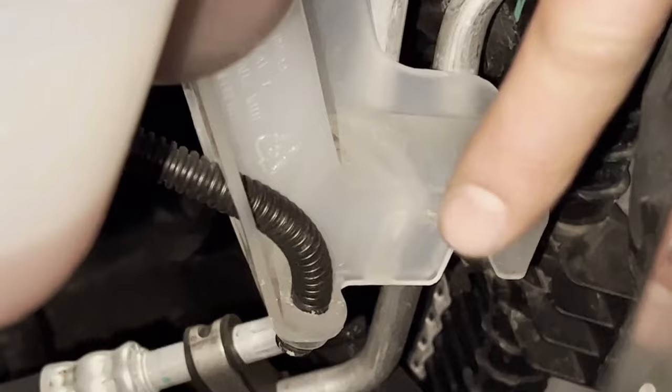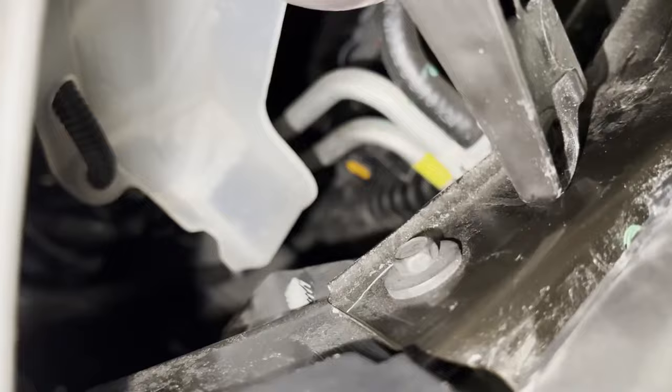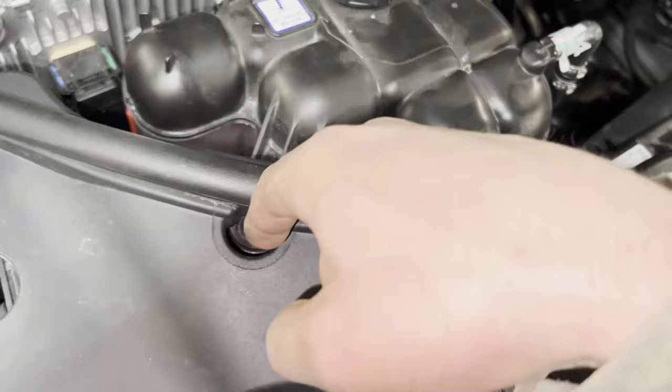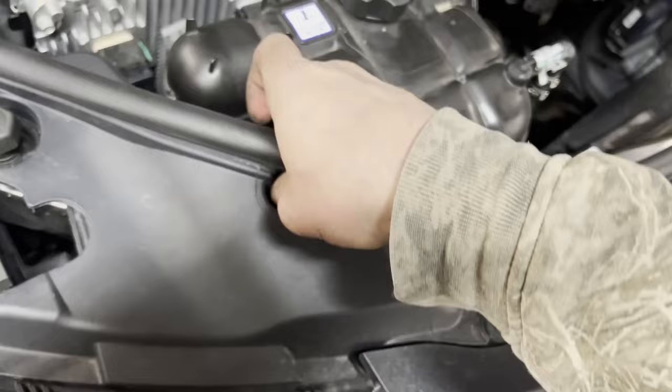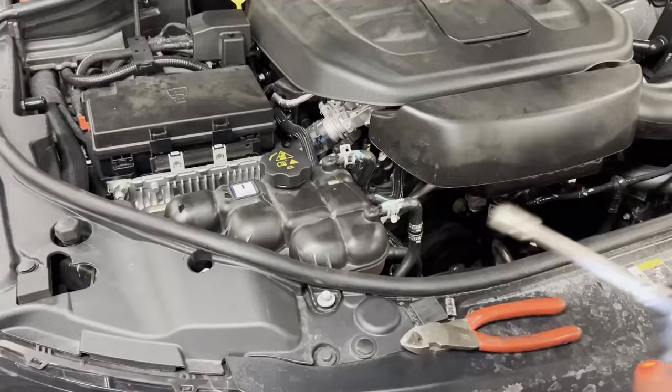Carefully wiggle the reservoir — be very careful not to break anything, it is just plastic. Get the reservoir notch up onto that bolt shoulder, then get the tab underneath the little weather seal and pull it forward. I recommend starting the recessed bolt first since it can be tricky. Like during removal, reinstalling is easier if you put your thumb through and come from the bottom side with your finger to keep from dropping it in the engine bay. Then use the 10mm to tighten both bolts — just snug, not overly tight; you don't want to snap or strip them.